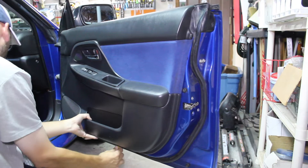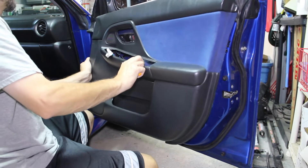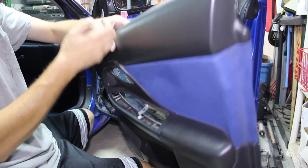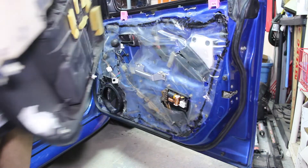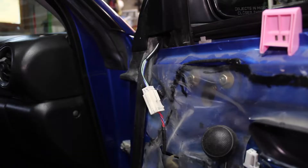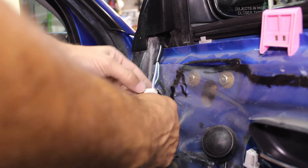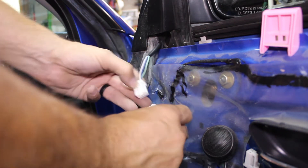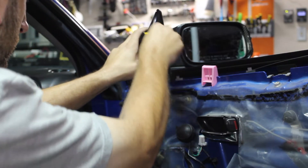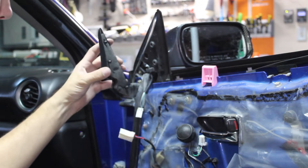Now you can take a panel tool or use your hands and work your way around all the pop clips — the door card is only secured by clips at this point. Once the clips are popped off, remove the door card towards you and up towards the ceiling to lift it past the two little pink clips — cherry blossom red for all you STI fans. Here's a quick look at the door card inside and the part number. USDM STIs do not have folding mirrors, just adjustable mirrors, and for the USDM there's only one electrical plugin. Using a panel tool or your fingers, pry the mirror trim up — it's held in by pop clips with a little padding on the back. Don't lose that.